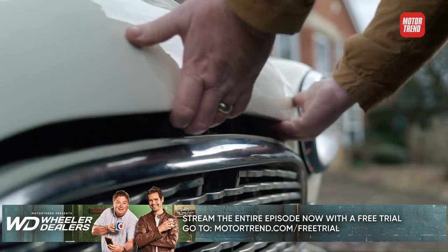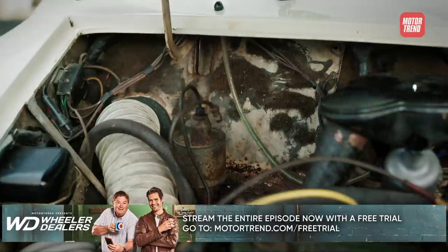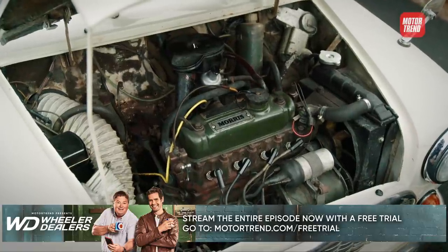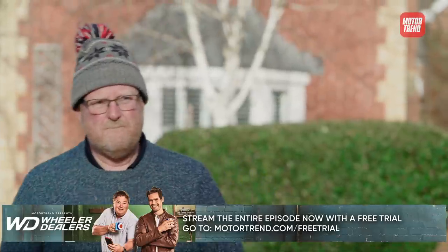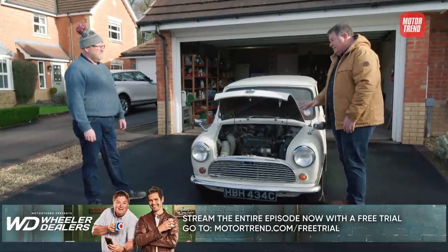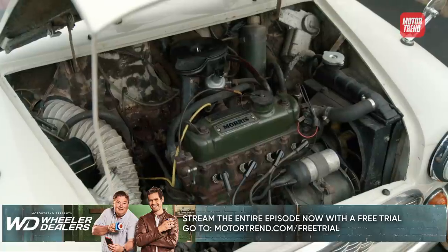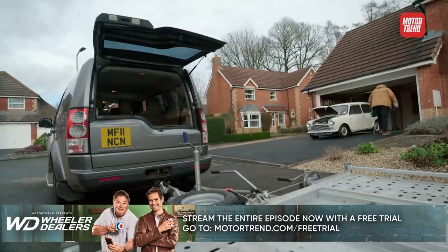Not the prettiest. I can see straight away we've got no clutch cylinders — took that out years ago. So that explains the clutch issue. But before this car gets fired into life, because it's been sat around for ages, there's a little sequence of things that we need to do and check. I've taken the liberty of bringing down some fuel, some fresh plugs, and I've got a battery on charge. Blindly firing up a car that's been sitting around as long as Ethel risks seriously damaging the engine.